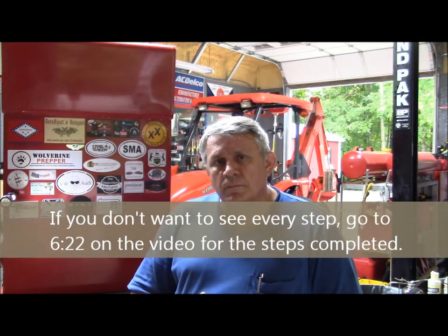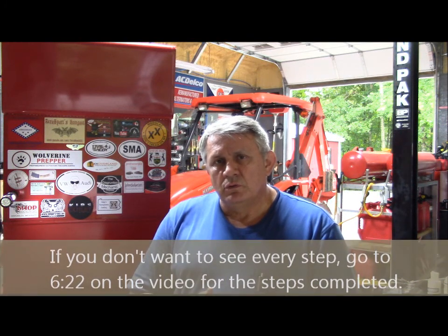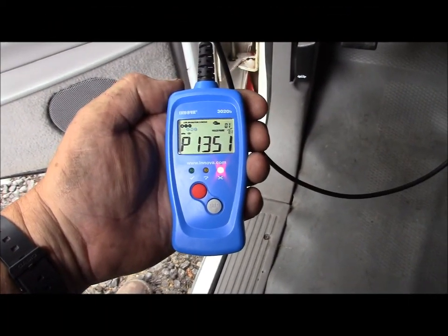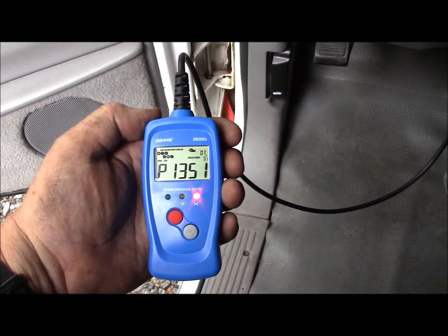Scannerdanner Premium, the lessons I've learned there, referencing back to his book. I've also got Scannerdanner's interest through his forum. And one reason I'm doing this video is so he can see the steps that I've taken to hopefully find out the cause. There are two warnings I've found in some references saying if you connect the battery with the key on, you can damage the computer. A P1351, I looked it up already. It's high ignition circuit voltage.